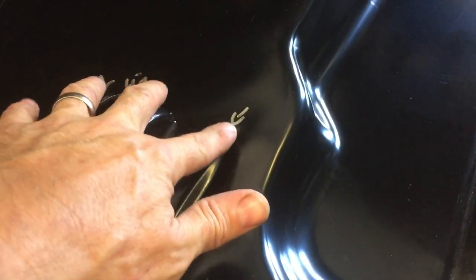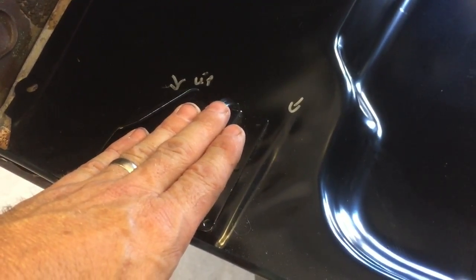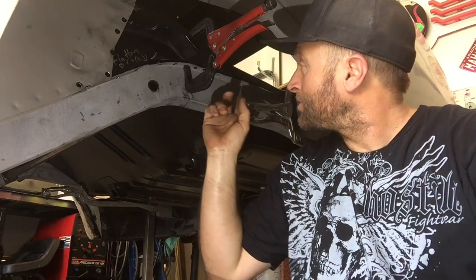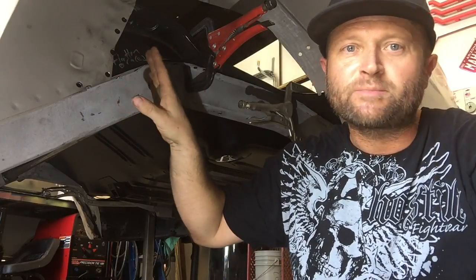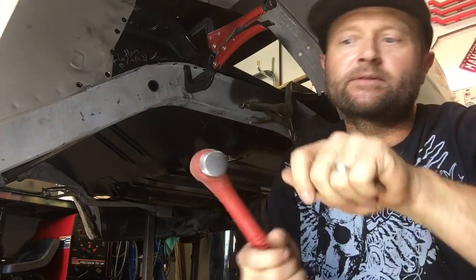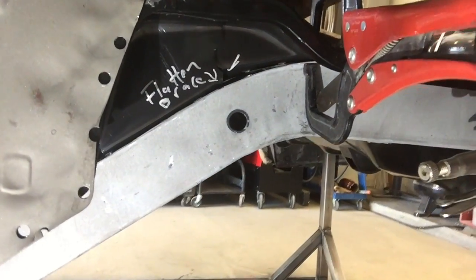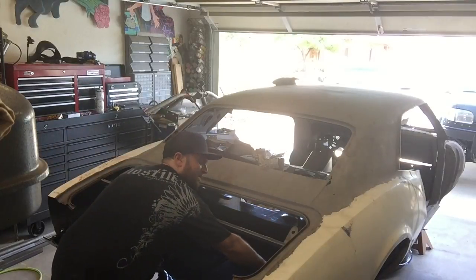One minor issue I'm noticing is in this area from the stamping and then bumper reinforcement welding — the floor pan's bent a little bit. Here at the frame rail flange all the way along I'm getting really nice fitment, but there's a third bracket in this shock mount crossmember that's in here and it's kind of left a little bit bulbous. So I'm going to take my hammer and a spoon and smack it down flat a little bit, and hopefully that'll allow this area right here to set a little better against the frame. Let's get this floor pan out of here and onto the stand so we can drill our plug welds.